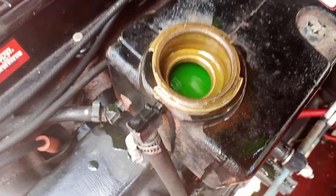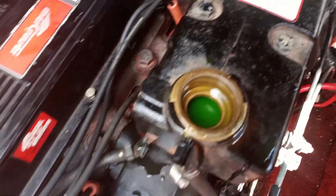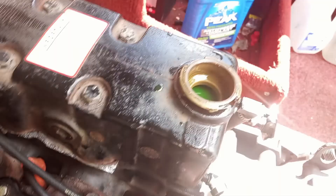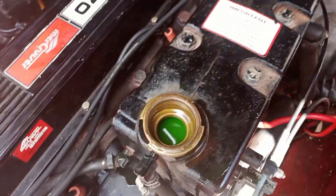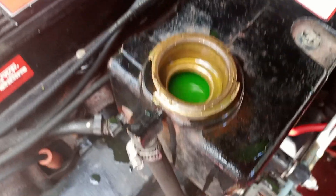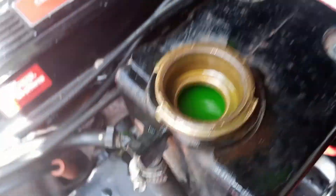There's another hose. Seems like I got all the air out, as much as I could. I think there's one more hose here — oh, that one you can't squeeze, and that one you can't either. So then we'll start it and the thermostat will open after a little bit, and the level should drop really fast, then we'll have to add more.